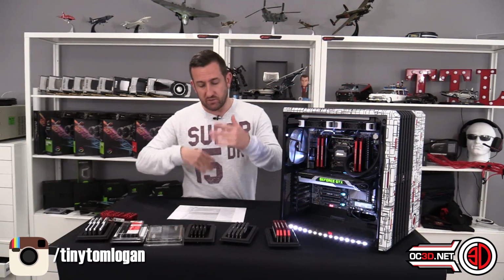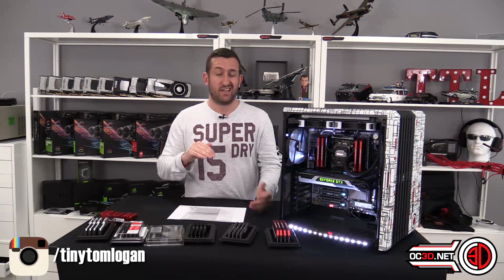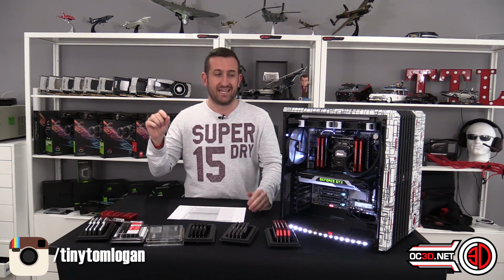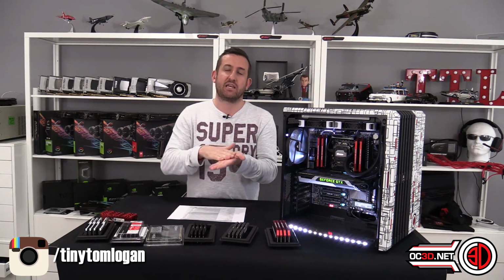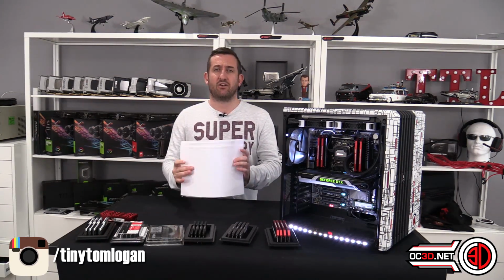And I will say at this point, when I was looking through these graphs, I actually went in, retuned my overclock, trying to turn things down, tried to fine tune the overclock, because in some aspects it was making me think that it wasn't quite 100%. And it was just that it didn't necessarily have an amazing amount more to give. Now that normally leans me into saying that the BIOS isn't maybe as mature as it could be, and it needs a little bit more fine tuning. You will see when you go onto the websites and look at the BIOS revisions, you'll see things like system stability. That's normally them going in with a bit of polishing cloth and making sure that everything's absolutely tip top, and that normally comes out in the overclock results. So I'm trying to explain as best I can. You'd be amazed with board performance how much it does come down to BIOS.